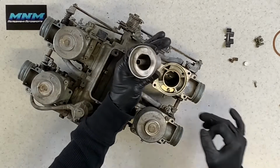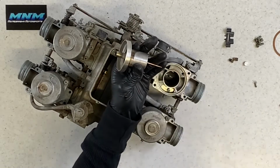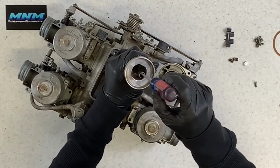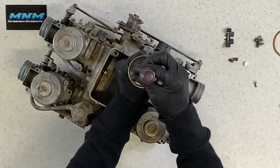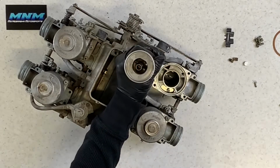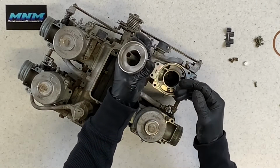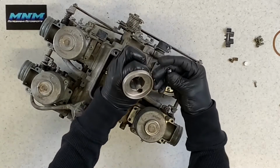When you've got this slide off of here, your needle's right there. Again, I said that this was replaceable. How you do that, you take a flat screwdriver again, stick it all the way down there. There's a flat screw that'll hold that needle in. You take and unscrew that. And then I keep a hold of that needle, don't let that fly out. Take that cap, you can tip it upside down, just dump that out.